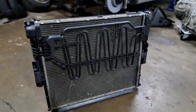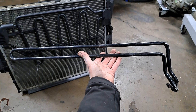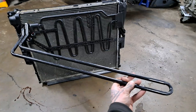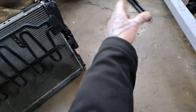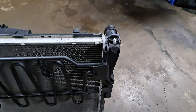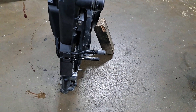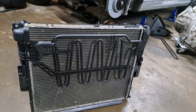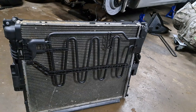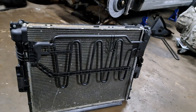Moving this aside, you can see the power steering cooler from this X3, which I really enjoy compared to the stock E46 one. If you ask me, there isn't much cooling efficiency going on with the E46 unit, so we get rid of it for this nice X3 one, which also uses the same exact location for the quick-connect hoses for the power steering system. Unfortunately, this cooler was a limited release and was updated to a different part very early on, so finding this exact cooler is pretty hard.